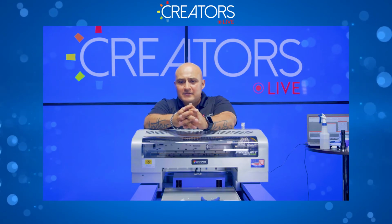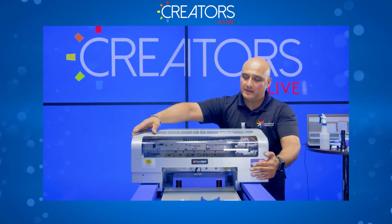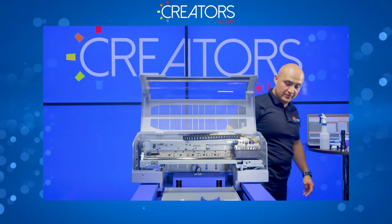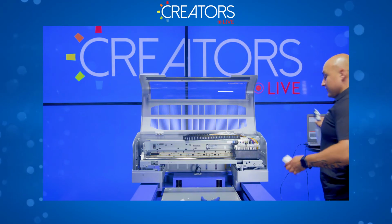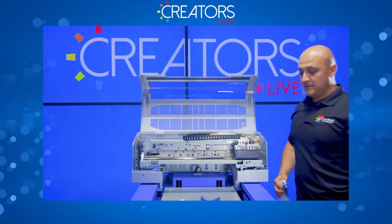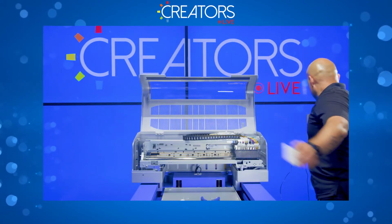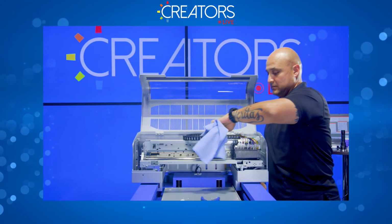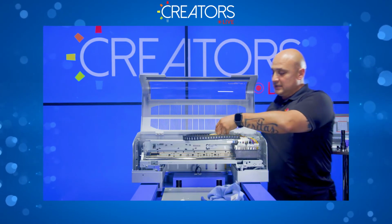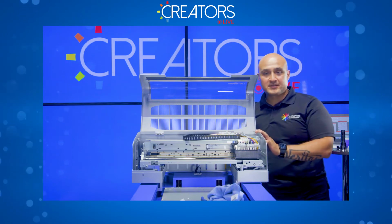All right, and what else? Do you clean the silver part at the top of the printer while it's open? Are you talking about this cover? If you're talking about this cover, yes, absolutely. If you want to add that to your maintenance, feel free to do that, and you can use the magic eraser with alcohol. Just spray a little bit. Remember, don't have it too soaked, and then you can just scrub it. Get your microfiber towel and dry it. But when you're doing this, be careful not to pull on these ink lines, or spray alcohol on top of these chips.